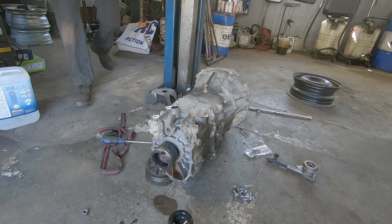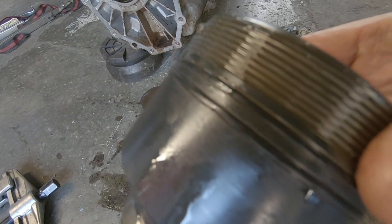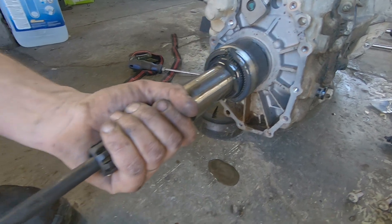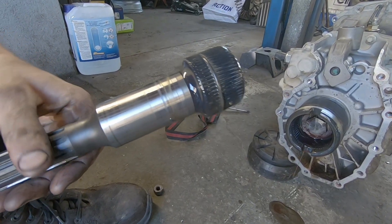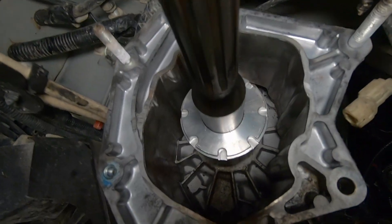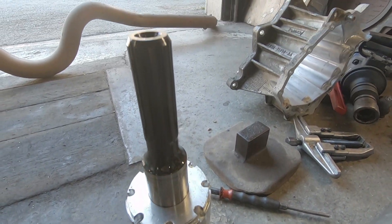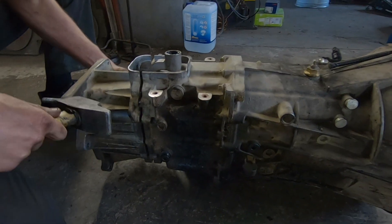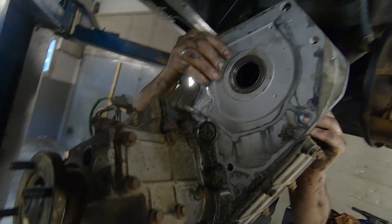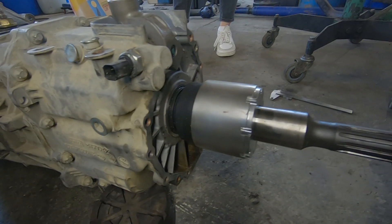Our concern with the Ashcroft part is that there are still two design issues that are not negligible: the o-rings and the special tool needed. Their part has two o-rings that keep the oil from the gearbox inside the part. Unfortunately, over time these o-rings will eventually no longer be tight enough and the gearbox oil will start to leak. This is exactly why we made the decision to take everything apart — which was the case for us. We had the second version, the one with a blue painted aluminum part. The one now sold by Ashcroft is red — they use different colors only to differentiate versions. But if the sealing fails, you still have to remove everything to replace the two o-rings, and this is a huge job.